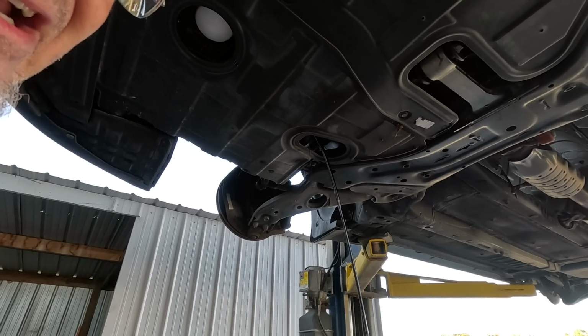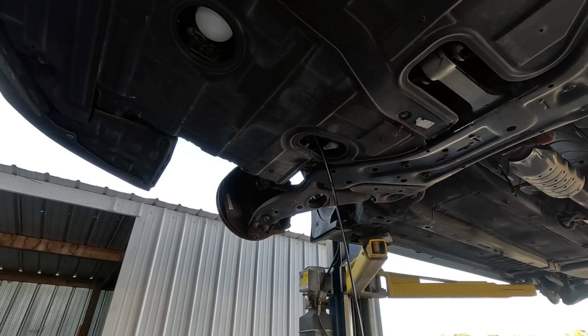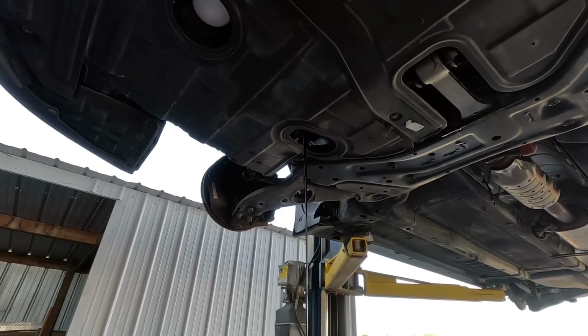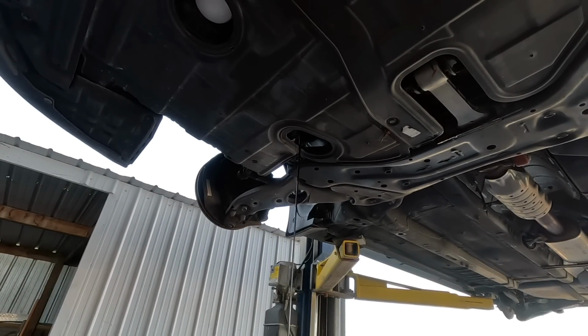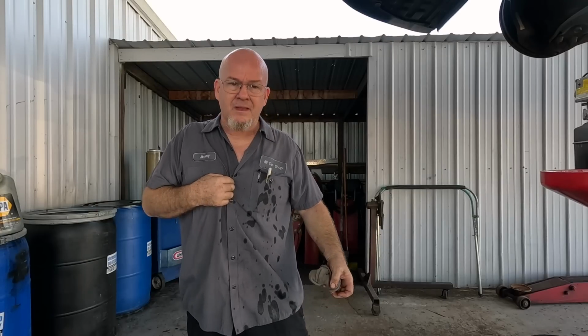That oil does look kind of dirty. Maybe it's good we're doing it early, because synthetic oil change we recommend at 7,500 miles. I just got oil all over me, just so you guys know. Cool, man. That is cool. 7,500 we recommend synthetic oil changes, and he's at about 5,800 or so. I like to do them at 5,000 myself, and then conventional at 3. That's not what we're doing. Not up to me. You guys know that. That makes me a little bit sad.